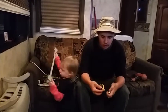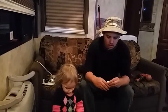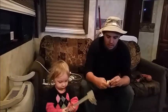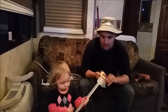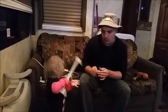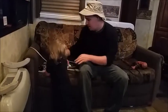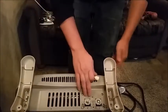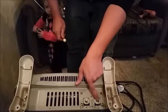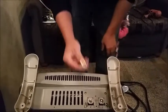Basically we're gonna put it together. Starting on the appliance itself, we're gonna wrap our fittings with plenty of this Teflon tape. What this stuff does is it guarantees you don't have gas leaking back into the house. This heater has an LP and a natural gas side — the plug has to stay in the side you're not using, so don't take the plug out of the natural gas side.